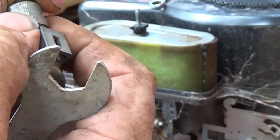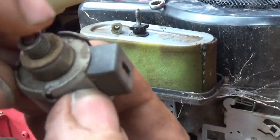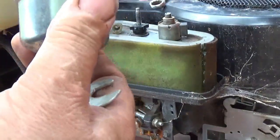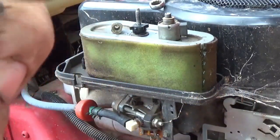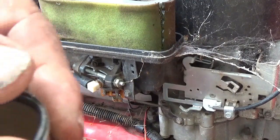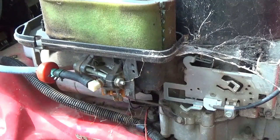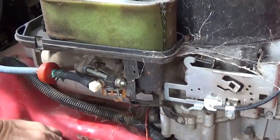This one here has a gasket on it, so I'm going to pull the gasket off and put it on this one. This may not be the right one, but normally this end comes to a point — like a needle valve where it pops up and shuts the fuel off. This gasket doesn't look like it's in the best shape, but it should work. I'll put a little dab of grease around there — the grease will help hold it in place. I'll get on my knees to see up under there better and get this centered without slopping it around and knocking the sediment bowl out.